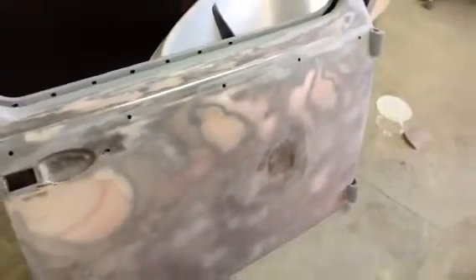The other door isn't quite ready yet — there it sits. We had to do a little bit of spot welding right there in the center and that shrunk the metal, so we've got to go ahead and get the torch and expand that again and kind of get it straight. This fender we did some welding on today.